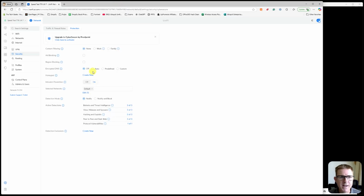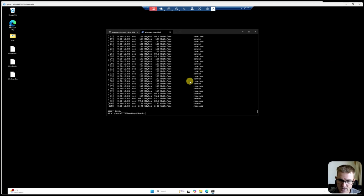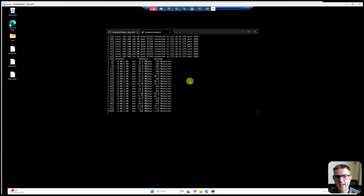If we now want to come back here and probably a little bit more, we can just turn on our family content filtering. This really should actually have no effect. The ad block should really have no effect on it as well. So we'll apply that, because those are really for web surfing. We're not doing that at the moment. We are only doing basic scanning from intrusion prevention. But I just want to see, because sometimes we do see a little bit of a decrease when we have those services turned on. So let's have that test run through again.